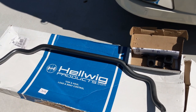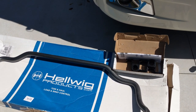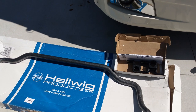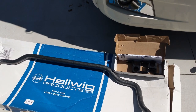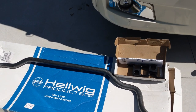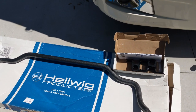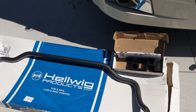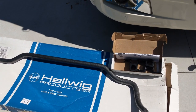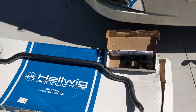We invested $1,000 in doing it. We've already done a wheel alignment on the front, and that has really helped in our driving. It tightened up the steering wheel — there was a dead spot where you had to move the steering wheel an inch or two in either direction before it actually seemed to do anything. So that cleared that up, but still when you go by big trucks, you get some bouncing and sway to the right. Even making turns, you can get some scary feelings on a sharp turn or going on bumps. So we're hoping this works out.